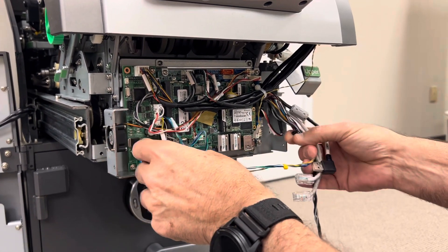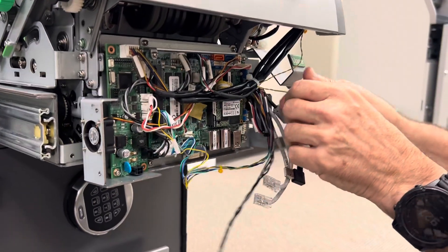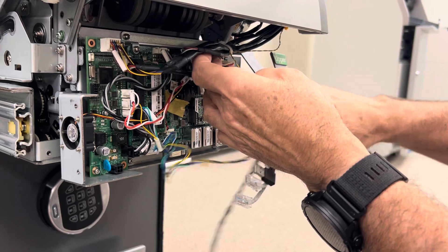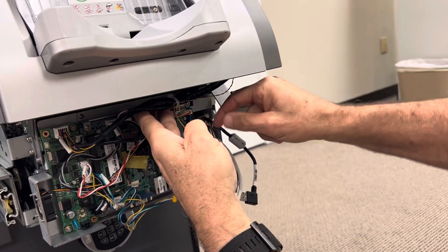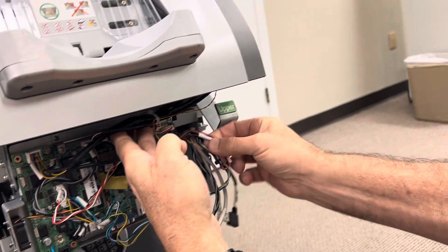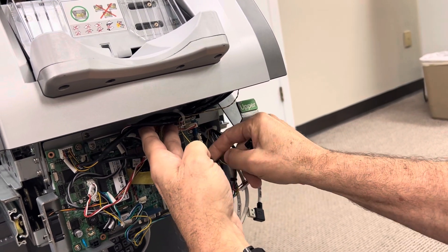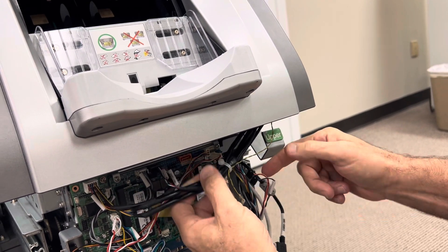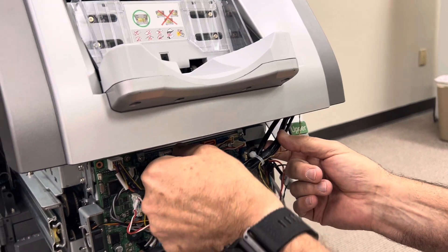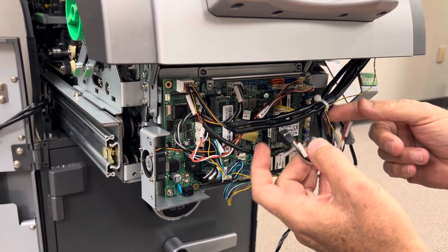We like to say that the release tabs point towards the fuses. So I'm going to remove that. The small wire that you need to be careful with is the speaker wire. There are several alarm wires, and they are all labeled. The first one is alarm three at the top, so it goes three, two, and one. It is important that you get those in the correct order.